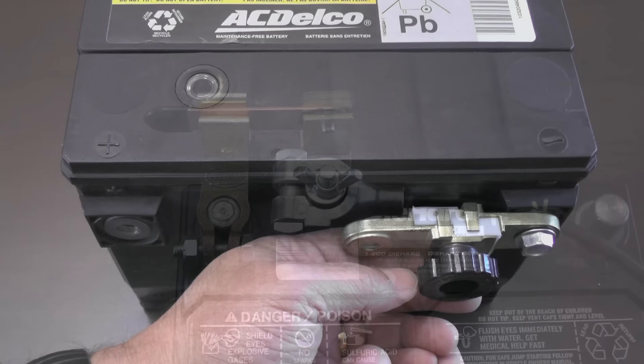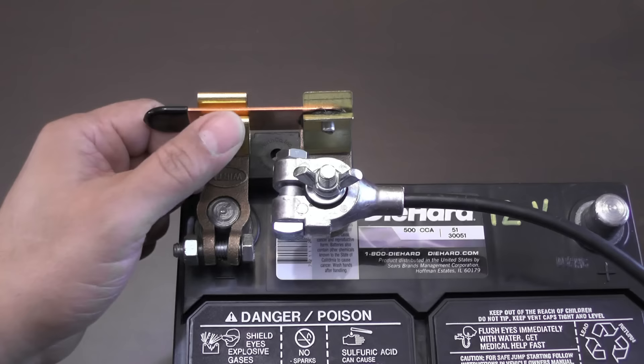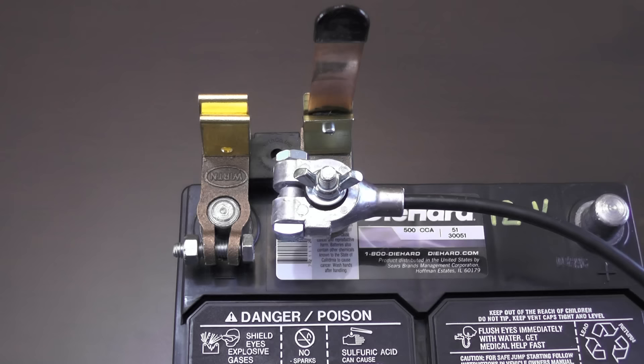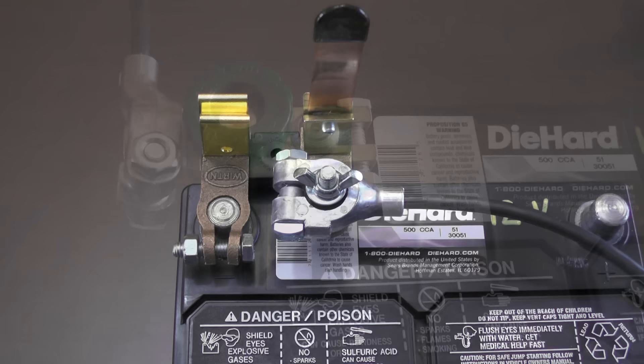So why is there a warning mentioned in this video? All battery disconnect switches add additional exposed area to the terminal it is connected to, whether it be a top post or side post disconnect switch. As you can see here with this knife blade type switch, when the switch is closed or open, the exposed metal surfaces can more easily come in contact with other metal parts within the engine compartment.